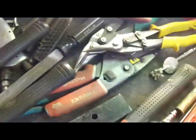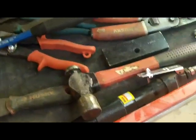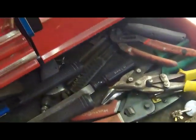I don't have a whole dolly set. All I have is this teardrop dolly, and I have this flat piece of aluminum that I use sometimes. Those are tools for knocking down your high spots when you're pulling out a dent with a stud welder. A stud welder is something else for pulling dents that you don't have to have, but if you can't get behind a panel, say you've got a dent in the middle of this fender, well, there's an inner panel on that, and you can't get back there because it's double-sided. So you would grind off the area where the dent would be, weld your pins to that, pull on them, and then tap down on a high spot around there. Of course, that's imaginary because I don't have a dent to show you.